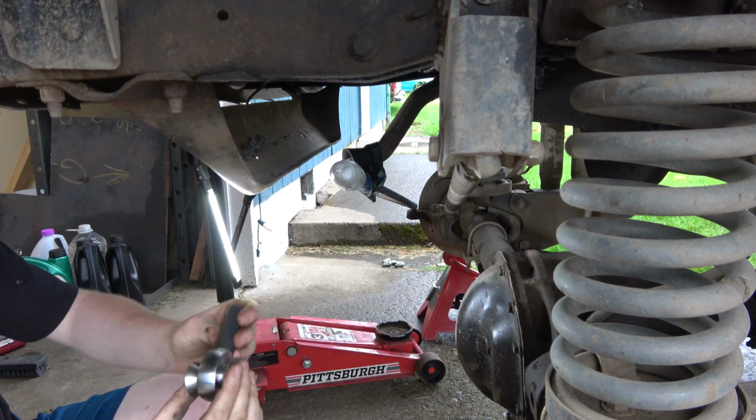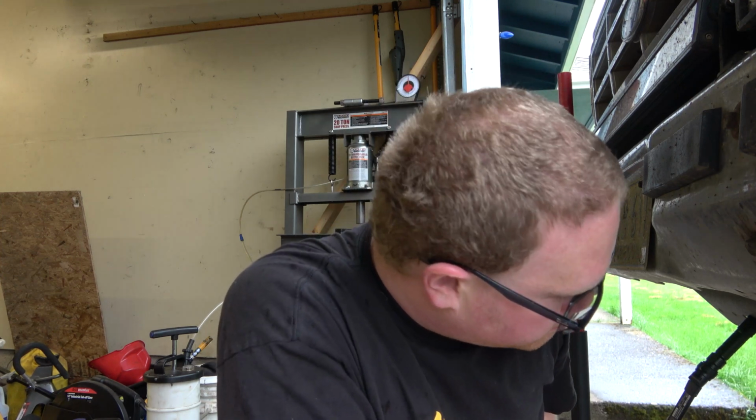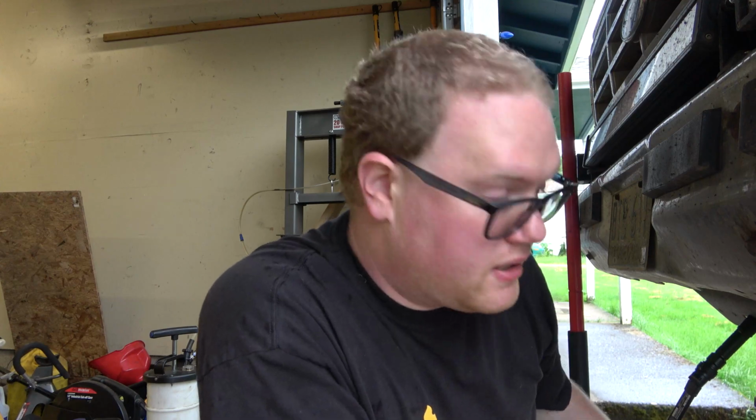So the only thing I don't like about this, I feel like it's a little limited. I want to get some PVC pipe, because I'm going to use that as our mock-up tube, so we can mock up our links. That way when we cut up our actual tube, we're doing one round of cuttings. We're not having to order more tube because we screwed up.